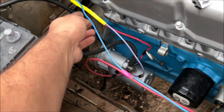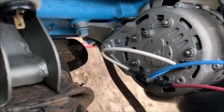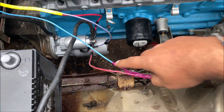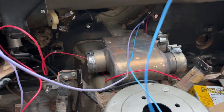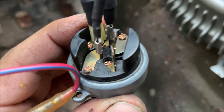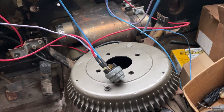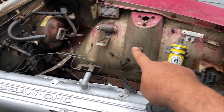On the charging system we only have one wire going into the dash, coming off the battery, joined and then wired up to the alternator — just like the diagram. We're wrapping it in purple, and in the next video it'll be wrapped all the way through the firewall so we can see the different circuits side by side. The exciter wire goes through the firewall and hooks up to accessories on the switch — you can see the 'A' for accessories. Notice IG is left for ignition and R is for the ignition system, which we're wiring in the next video.